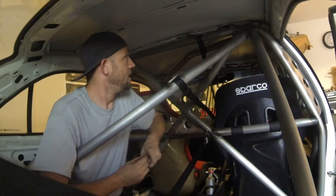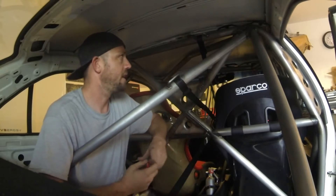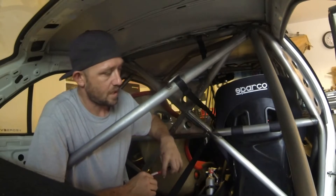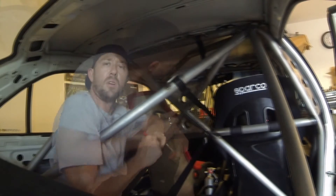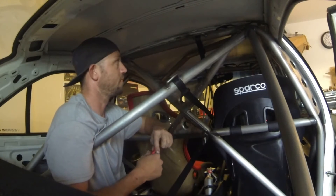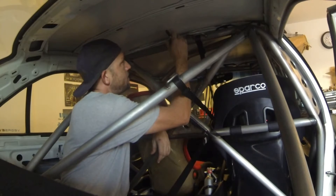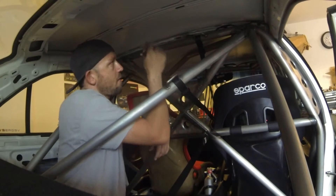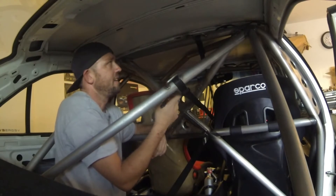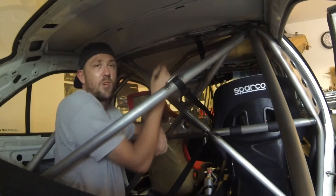What I'm going to do is pick a few different locations. Most of them are on the bottom sides or underneath, and they're typically away from areas that are going to be accessed. One area I absolutely put holes in the same spot every time is my main hoop — I usually just stick one in the back. I normally follow and chase everything with a marker first, so I can erase it if I change my mind, since I can't weld the hole back up.